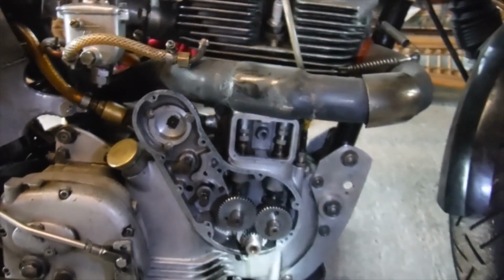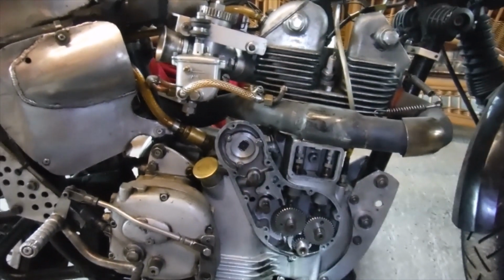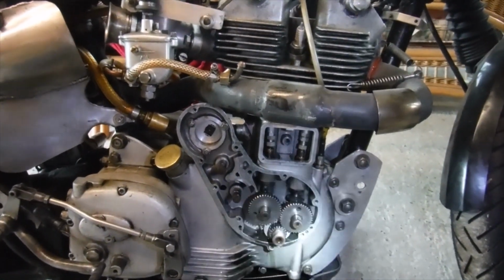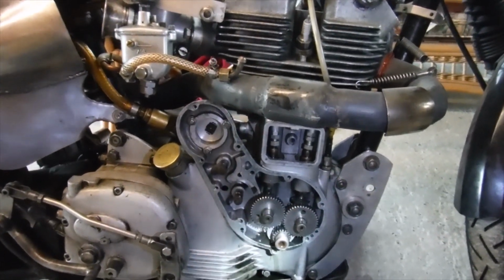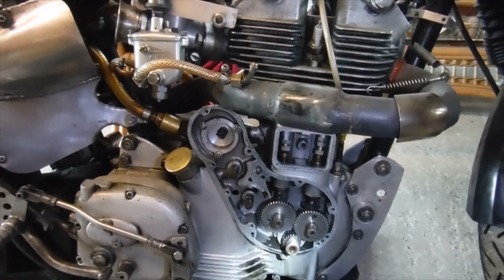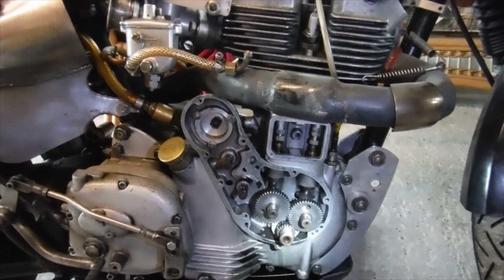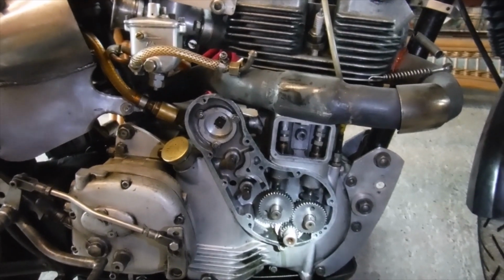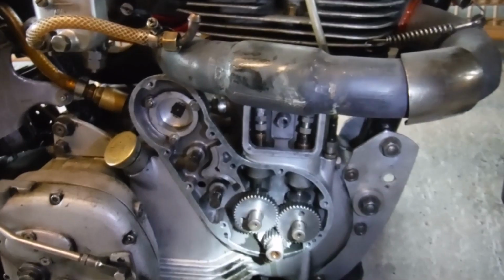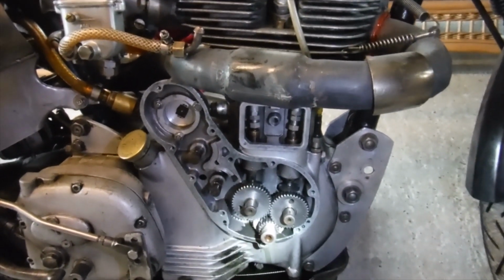But obviously we get wear and tear and breakages, and then we had the lockdown, and the cams that were in it when it was really successful got worn, and one of them got a couple of broken teeth as well, so we sent them away to be copied. What we got back eventually, I'm just fitting them now, are not exactly the same as it happens, but I'm putting them in, but they have a little bit more lift on them, so I was concerned with how much room I might have for valve lift.